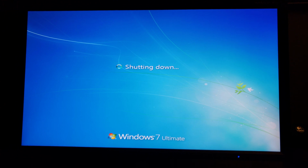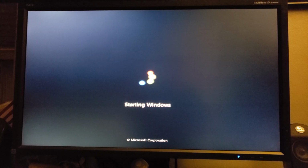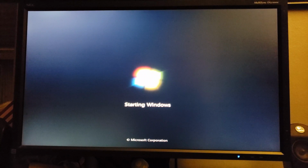Now around this time, if you actually did get into Windows 7 and you decide not to reboot, this would be a good time to shut down the computer and get ready to migrate those files, the chipset drivers, the experimental USB 3.2 drivers that I showed you. And again, I will definitely have a link to all this stuff below. Chipset drivers, obviously, you can just get off AMD's website or the motherboard manufacturer's website as well. Might want to just get off AMD, it's AMD's latest stuff. And any other drivers that you want to also put in. Not necessary right now. The only two things we need are the chipset and the USB 3. We will be installing the chipset driver first. Very important to do that before you attempt to install those beta drivers.